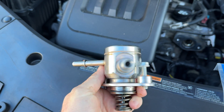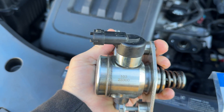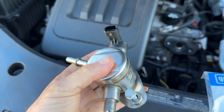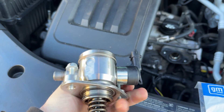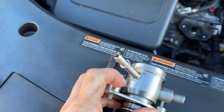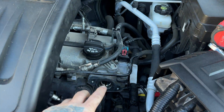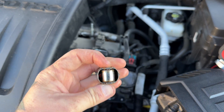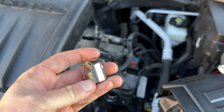Here's our aftermarket pump that we've got taken out. I don't know what brand it is — there is that part number on it. I asked the customer and he didn't know; he thought it was a Standard but couldn't remember because he bought it a couple weeks ago. This is the aftermarket one I took out. When you take these out, always pull the roller out of there and give it a good inspection — make sure there's no pitting or anything on it. This one looks fine.